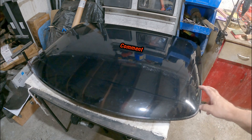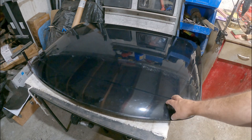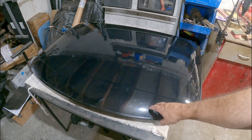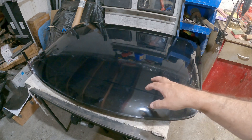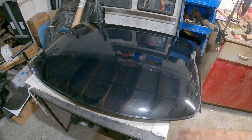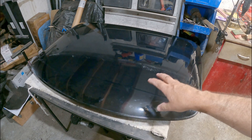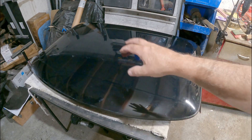For anyone who doesn't know about my 1990 Corvette, I now have over a quarter million miles on it. I have two tops — a solid top with carbon fiber vinyl wrap on it, and the transparent one which originally came with the car. When I got this car it had 163,000 miles and was basically a basket case. This top was horrible looking and I sanded it down and clear coated it with 2K two-part clear, and that held up real good.